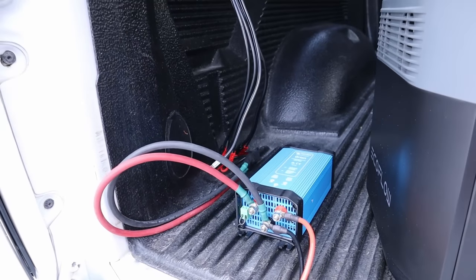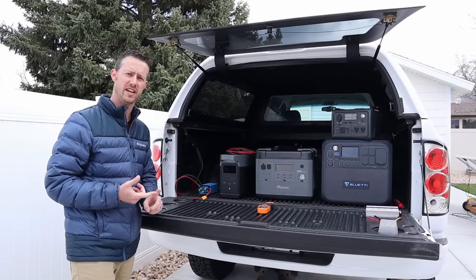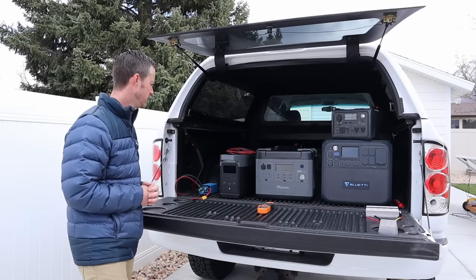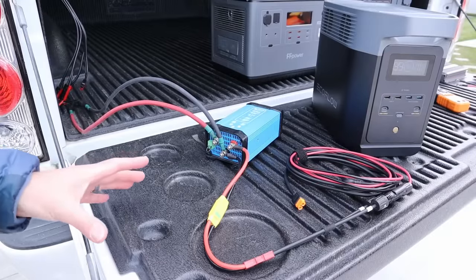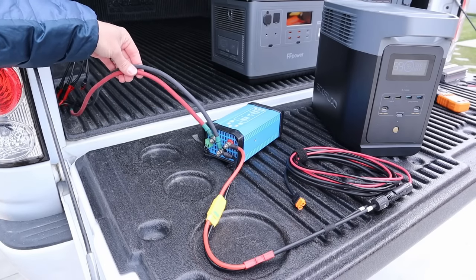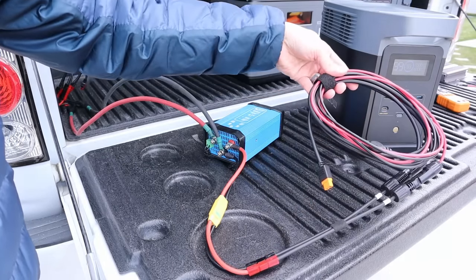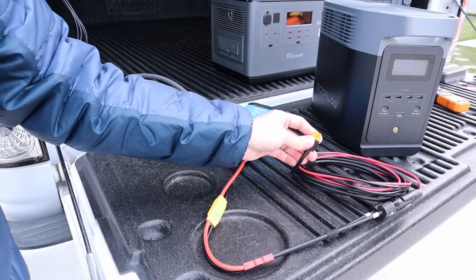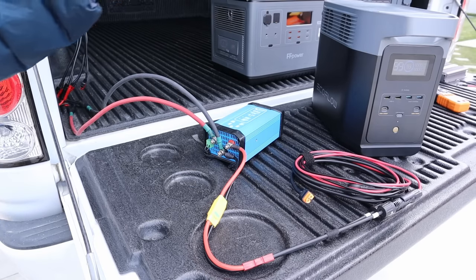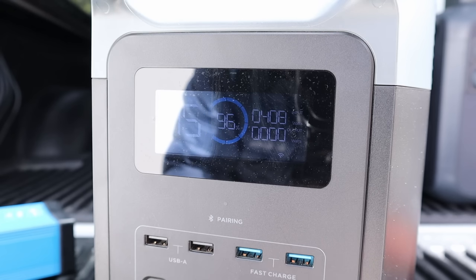Starting with the EcoFlow Delta II, I'm going to be using the Victron Boost Converter. A lot of people are going to go to this one because it has the built-in fan and it's from a large brand name, so it has some credibility there. This is how the Victron connects up — I have this going to my six gauge wire in the truck and I have 10 gauge wire coming off Anderson PowerPole to MC4. This is the MC4 solar charging cable that came with this unit, with the orange metal tip charging port that allows it to charge at the higher rate. With the truck idling and the Victron plugged into the Delta II, we're getting 409 watts charging input — four times faster than just charging off 12 volts alone.